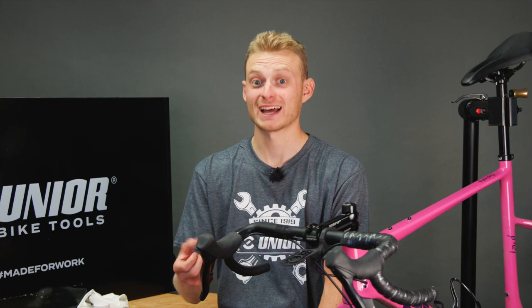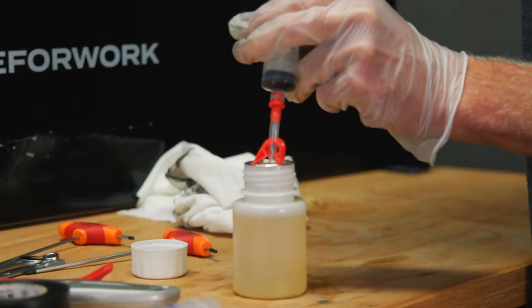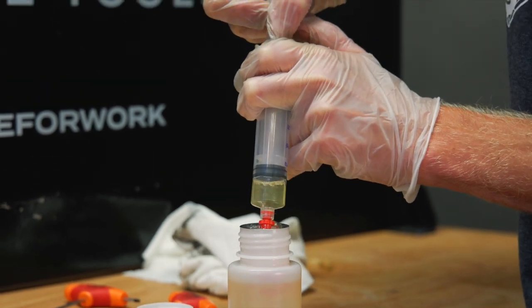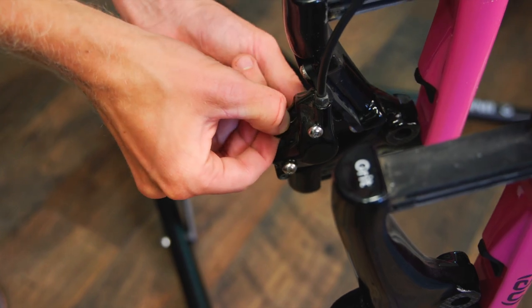Hydraulic disc brakes work on the basis that brake fluid is not compressible. However, if there's air in the system, that is compressible and it can make the brake lever feel mushy. We can overcome this by bleeding the system and replacing those trapped air bubbles with hydraulic fluid. First, put on protective gloves and fill your two syringes — one quarter full and the other half full. Try to avoid getting any bubbles in the syringes. Remove additional air bubbles by tapping the syringe with something hard such as an allen key and then push them out using the plunger. Always bleed brakes with the pads removed to avoid contamination — if you haven't already, remove them now.